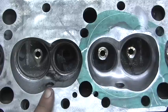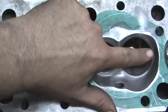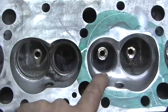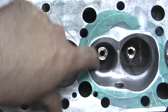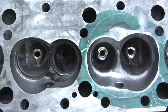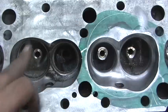You can see the difference in the combustion chambers — look how we got a slope cut away for the spark plug and then opened up here, totally different. You got your big slope here but this comes up and closes up the exhaust port. There was quite a bit of meat I was able to take out right here and over on the sides. Now I'm going to get a good effective burn. There was a lot of meat buildup right in here above the seat — I flattened that so I can roll the 30 degree or 15 degree angle into it, whatever I want. You can see right here I modified it and cut it.